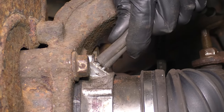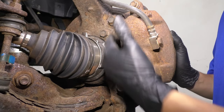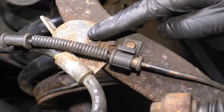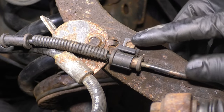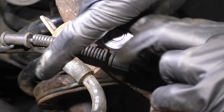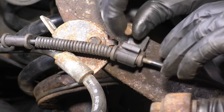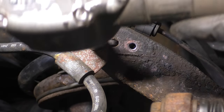On the back side of the knuckle, you have the vacuum hose for the four-wheel drive hub. Pop that off and set it aside. Now from the back side of the knuckle, we'll have to unbolt the caliper from the knuckle — the whole assembly with the bracket — just these two 18-millimeter bolts. Before we do this, the brake hose attaches to the knuckle and the ABS sensor as well, both of which we'll have to remove. Let's start with the ABS sensor, which has an 8-millimeter bolt going through it. Then, with a 10-millimeter socket, remove the brake hose bolt.